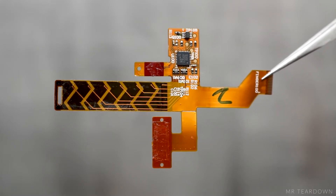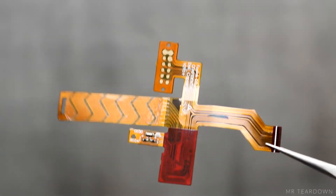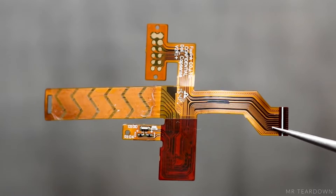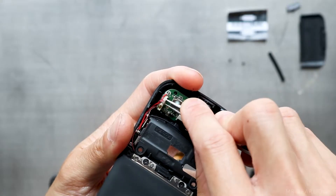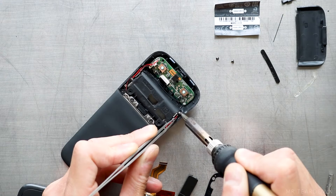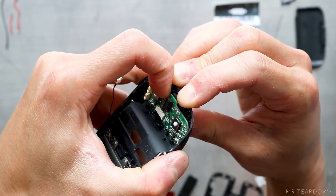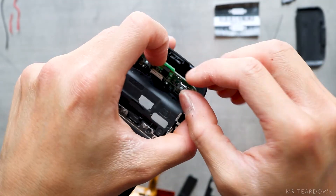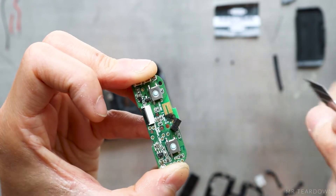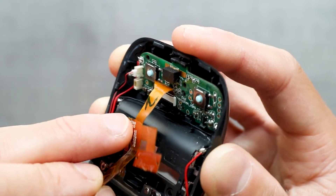This is how the flat circuit looks when it's completely flat. I love looking at flat circuit design because the designer can get really creative — including different functionalities and connecting different bits of the device together with the same piece of circuit. Another connector can be unplugged, and I can then desolder all the wires connecting the battery terminals to the PCB before removing the PCB from the undercuts on the housing. A small piece of foam on the PCB separates the flat circuit from the Bluetooth antenna so they don't touch or interfere with each other.